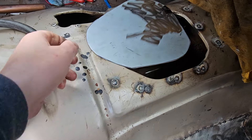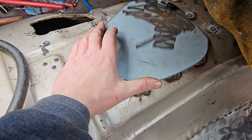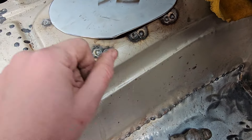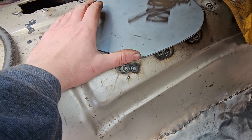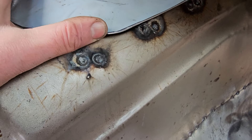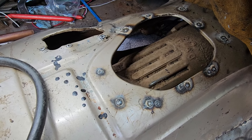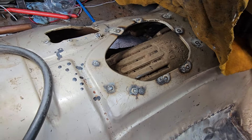We're back — got that piece cut out. Since the transmission tunnel is not flat, I need to form this piece to it. I'm going to go over and hit some of these with the flat disc so that when this overlaps — I did make it a little larger so it kind of overlaps that hole — this edge will lay over flat. Those spot welds are going to mess me over, so I'll do that real quick, get it tacked in there, and show you what it looks like.